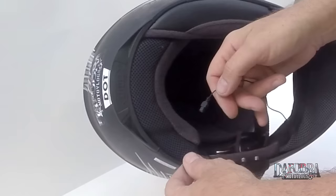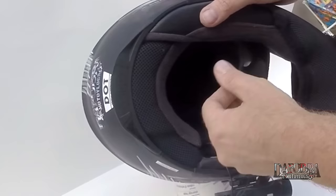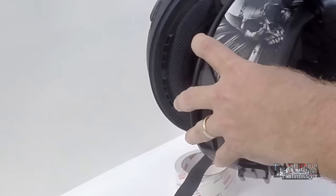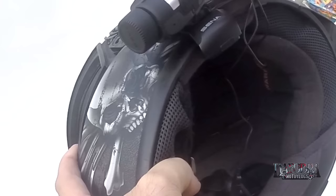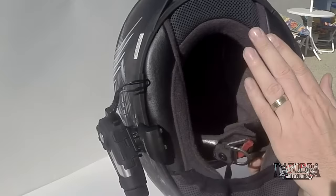So the speakers and the wired mic are installed - I'm going to plug the two of them together. Plenty of room. We'll tuck these out of the way once I put the cheek pad in, you won't see any of it. And then this plug, which has the speakers and the microphone plugged into it, will plug right into the back of the unit. Let's just make sure this thing works - we'll turn it on by pressing the jog dial and the phone button at the same time. Yep, she's working. Alright, let's button her up and take a look.